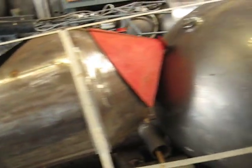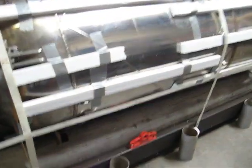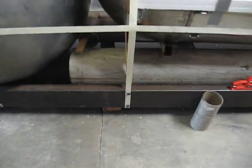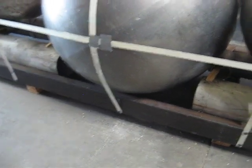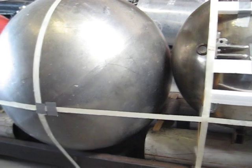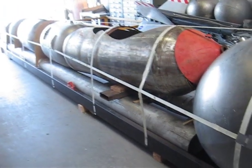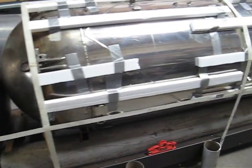Here are some of the cross ladder sections standing next to the chassis. The chassis itself is two-by-six quarter-inch wall mild steel, and everything else nestles and is stressed against the chassis with bulkheads. You can get an idea of the vehicle's lines by tracing those white strips of cloth.